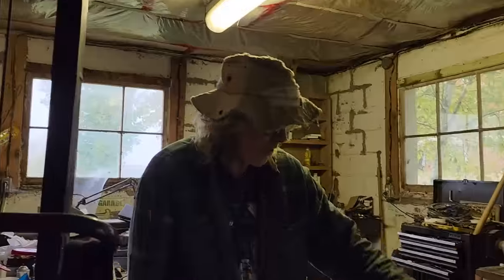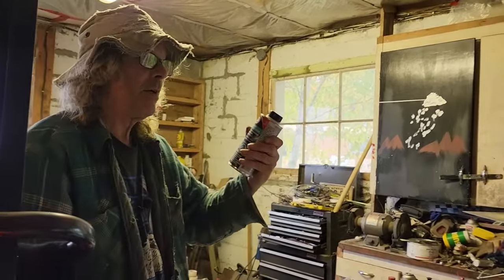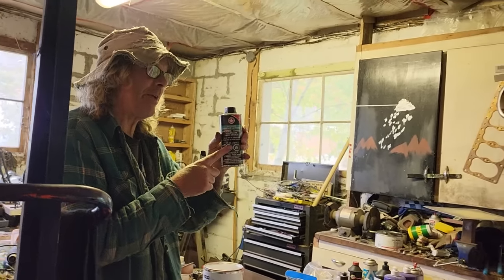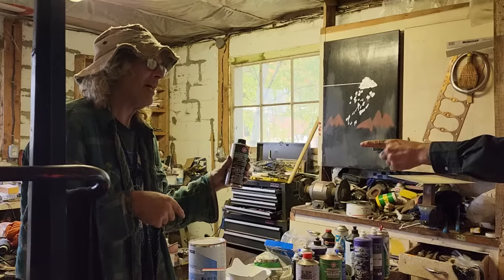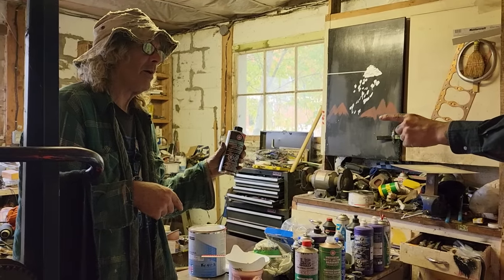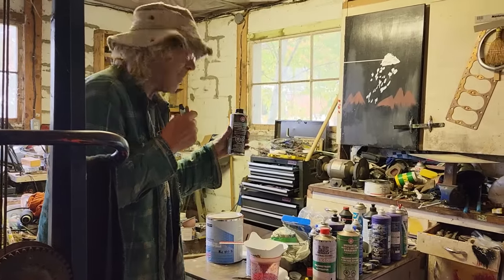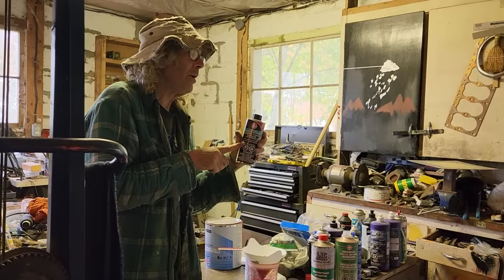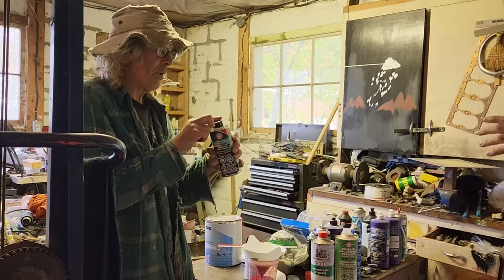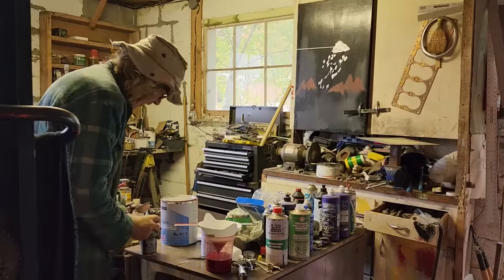And you brought some hardener. I did. Do you want to use that hardener? Yes, definitely. I don't really trust this one, because it's half as big. That's got nothing to do with the can. But they told me this is good for a gallon. Okay, but the can's... Something doesn't add up here. No. Go with that hardener. It doesn't matter the size of the can. It matters whether you get it up to five inside the paint, if you know what I'm trying to tell you. So the fact they told me that this is good for a gallon is wrong. It's got nothing to do with it. It will mix up a gallon of paint. That's enough hardener to make up a gallon of paint. But what I'm trying to tell you is, you only need to go up to the five, so that's lots. You've got lots of hardener. Lots. Okay.